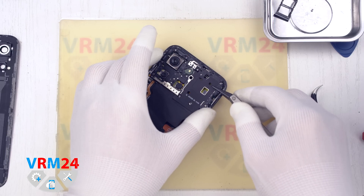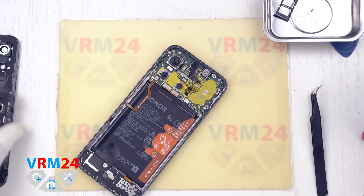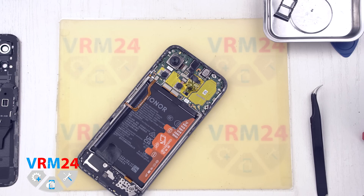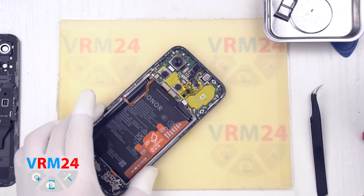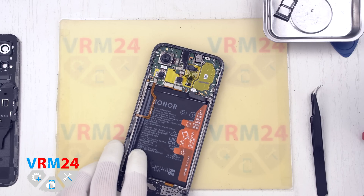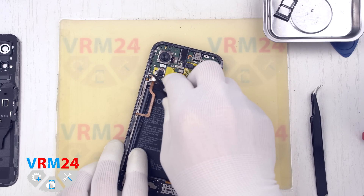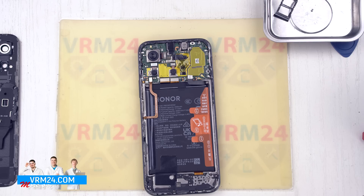The cover covering the motherboard can be removed along with the screws. We disconnect the battery connector with a non-metal tool first, then disconnect the cable to the sensor. We can also cover the cameras so that nothing gets damaged or dust gets on the lenses.